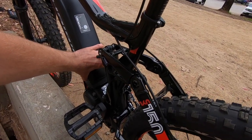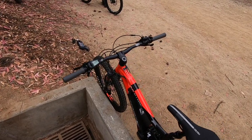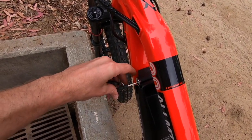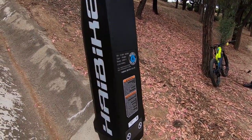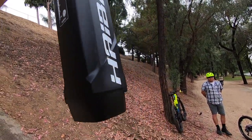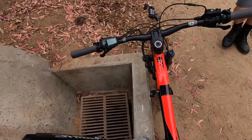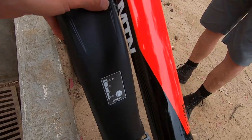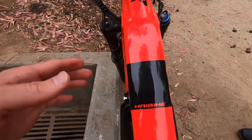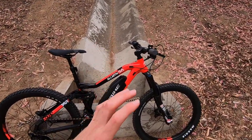I'd recommend taking that battery off frequently — it's a good idea to store lithium-ion battery packs in a cool, dry location and try not to let them go all the way to zero; 20 to 80 percent is really where they like to stay for longevity. Haibike has a pretty good warranty combined with Yamaha. I'm going to unlock it and slide the battery out to the side — it's a 36-volt, 13.6 amp-hour pack, very close to 500 watt-hours, with a little LED charge level indicator and a handle on top. Sam showed me that you take the key out, position the blades, tip it in — click — and it's locked. Pretty easy to remove.